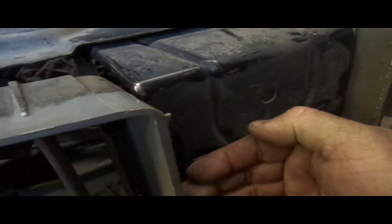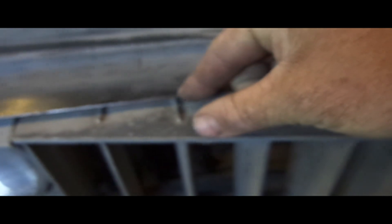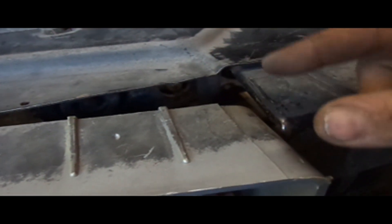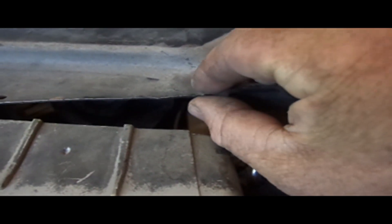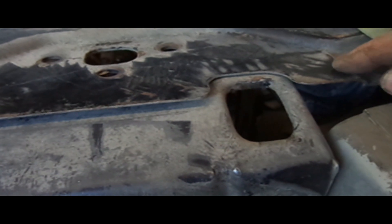What we're going to do here is just close this hole right off, run a plate across even with the grill. It will come up and tie into this angle here, come out and down flat, then curve back into the bottom. Now this hole here — I'm going to add a piece and just follow the grill all the way out. Then it's just going to curve down and tie into this plate. Close all this off, both sides. This rad support looks like it's off a different car and they just stuck it in here. I'm going to take this line, extend it out, run it along the front, and just close that off, tie that in. Just make this look like it's supposed to be there.